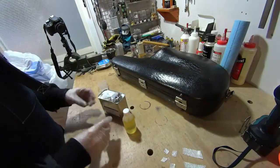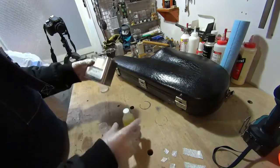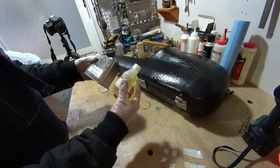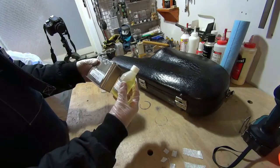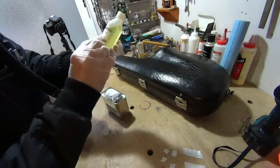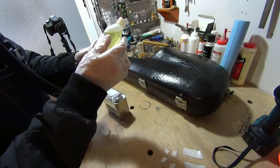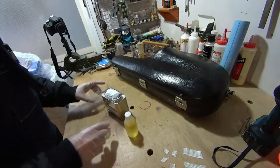And it'll tell you how much to mix of each, a hardener and some other agent. I'm not really sure, an epoxy resin and a hardener. And this is for fiberglass cloth, which is what we have purchased, so it'll be perfect. And it's a 100 to 30 ratio. So let's mix that up. Be sure to wear a mask when you're doing that.